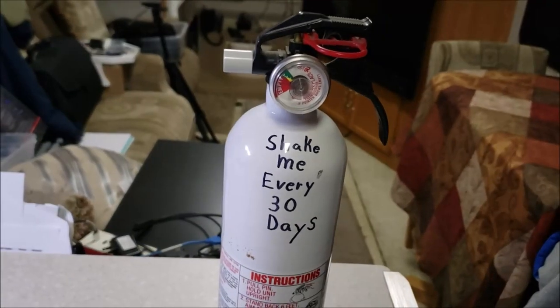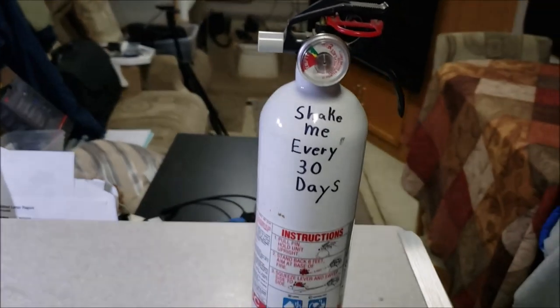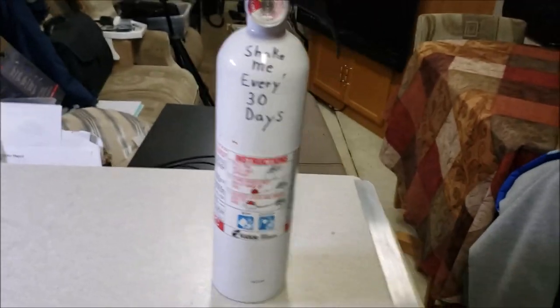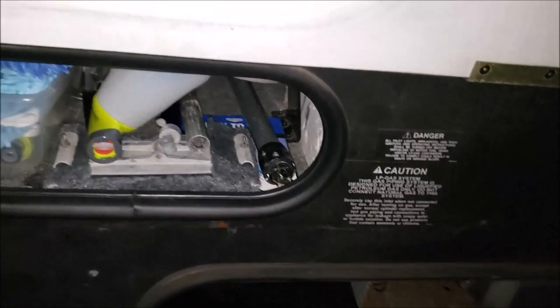While I was thinking about this, I called a buddy of mine who is the state fire marshal for Kentucky and asked him some questions about RVs and what he recommended. I told him I have these four or five pound extinguishers. He said he would recommend a minimum of a ten-pound extinguisher because these things empty really quickly. I was also reading online where they recommended each RV should have at least two fire extinguishers and then one outside in an unlocked compartment. So I'm going to upgrade to a ten-pound extinguisher, put it right there, and take one of the smaller ones and store it outside — usually where our propane tank is, since I never lock that door.